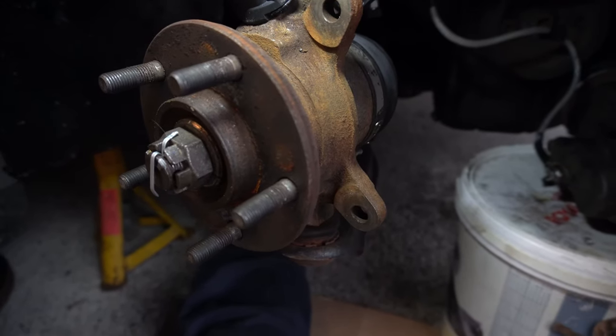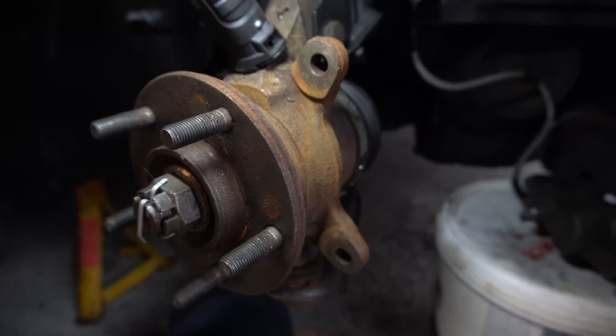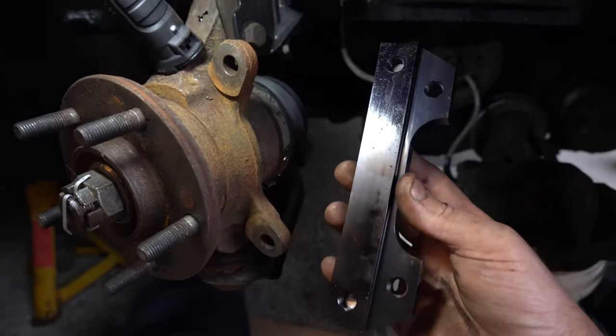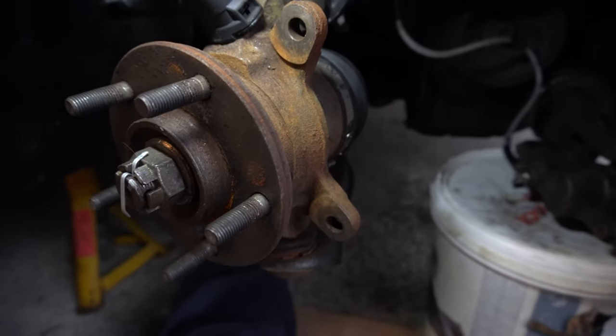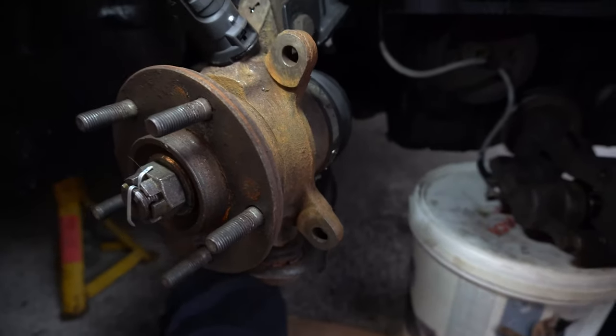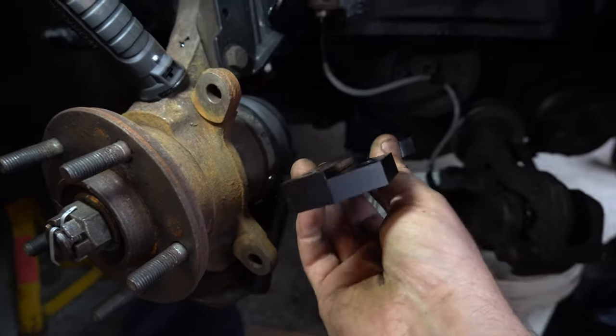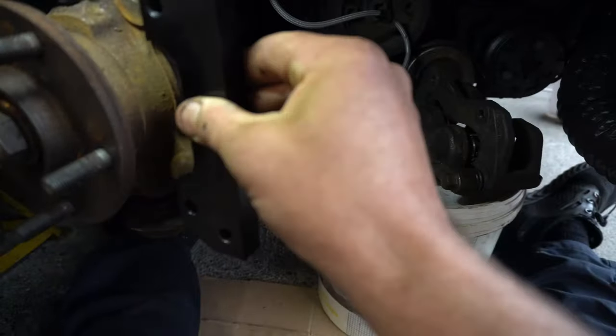Okay, so with the disc and the caliper off, this is what you're obviously presented with, your hub. By fettling, this is the bracket that we're going to be using to fit the GTO caliper. When they come from Freaky Parts, they are just bare aluminium. I've had it anodized. You can see there's a cutout, right? There's a step in it there. Hopefully you can make that out on camera. That's going to sit like so